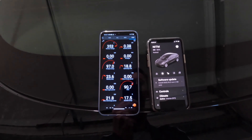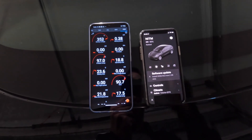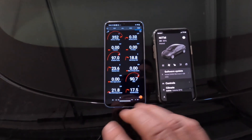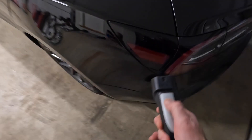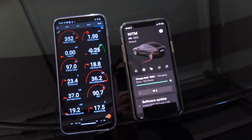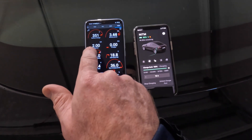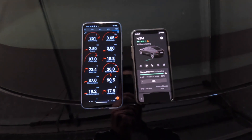If the battery's warm, it will suck heat from the battery into the cabin — we'll see that demonstrated in one of the coming videos. If I plug it back into power, we'll see that battery heating come back on again. There we go — we can see the rear motor powering up and the battery heater has come in again.